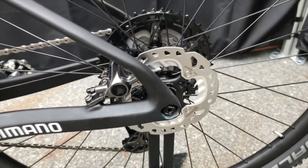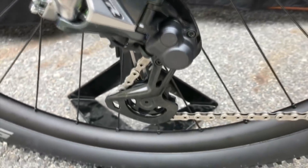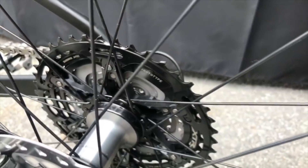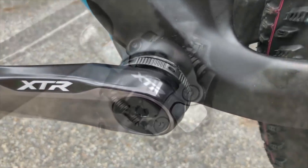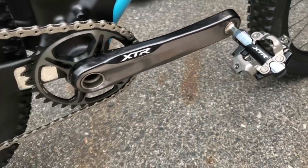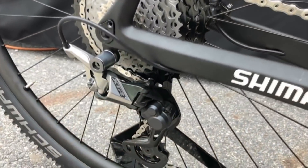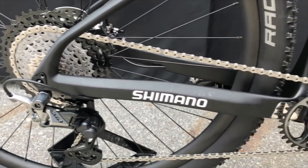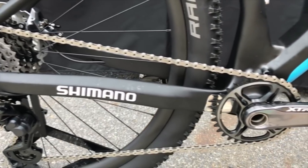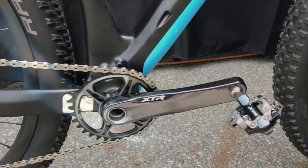The way I think about this groupset is that it's basically a showpiece for what Shimano can do. They've played a few games with SRAM with that 51-tooth ring on the back of the cassette, but the headlines on weight and drivetrain efficiency are spectacular. The bonded aluminium crankset, the triple-material cassette, the low weights throughout, the efficiency in the rear derailleur and the freehub — all amazing innovations available right now. It's just the problem with the hubs and wheels that's a sticking point. But I'll say it again: I think this is the world's most spectacular, most innovative bicycle groupset on the market right now.